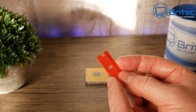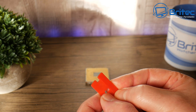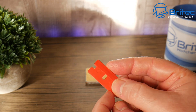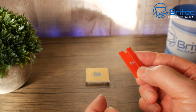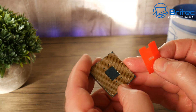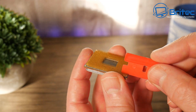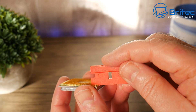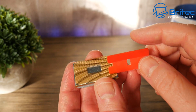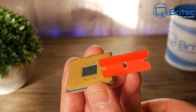I also use these plastic razor blades quite a bit. They're not sharp — just made of plastic and quite rigid. They allow you to go down the channels of the pins to try and straighten them. You push this down the channels to straighten the pins out. Generally I try to straighten the pins first, then I'll run this plastic blade down the channel to lever them over.